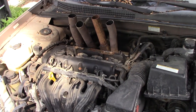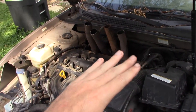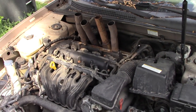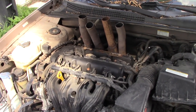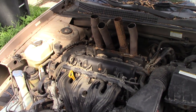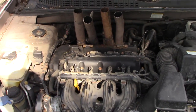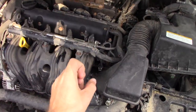As soon as I put these headers on, this thing fires right up and purrs perfectly smooth - right around 1,000 RPM when it starts cold, then as soon as it warms up it pulls back down to about 800 RPM. Running perfect, no misfires, no searching for any type of movement in the engine.